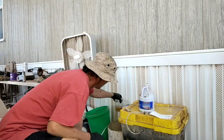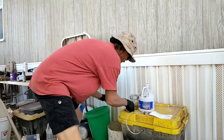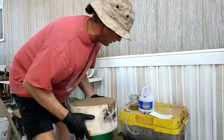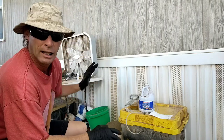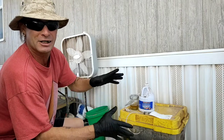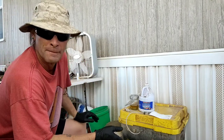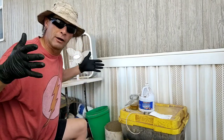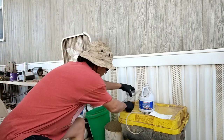Now let's check this one here — this is just a couple little pieces that I cut, that I chopped off of this right here. That's what's in that little mason jar as a test bed. Like I said, to see what's in this, because I don't really know. I didn't even know these biscuits were in the DPF filters. That section I've been throwing away because they were always facing down and I just assumed that was a different part. Until I pulled a whole one that hadn't been taken apart out of the trash and took the V-band clamp off — boom — there's ceramic on both sides. In any case, let's take a sample of this one.